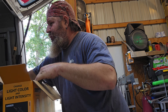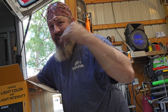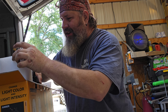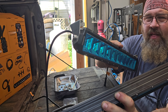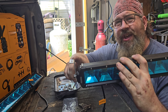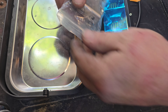Also in the bottom of the box it comes with drivers that look like this — an AC plug for each light that allows you to run DC or AC. These are going to be bank fishing lights for me. When I do that type of fishing I generally use a generator, so I'm going to run these AC. It's important to note that these brackets can be placed in either direction depending on your needs. The inside direction has bolts at 21 and 9/16ths on center, and if you flare the bracket out they are 23 inches on center.